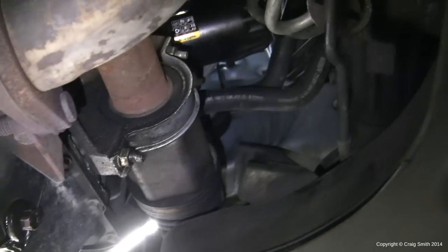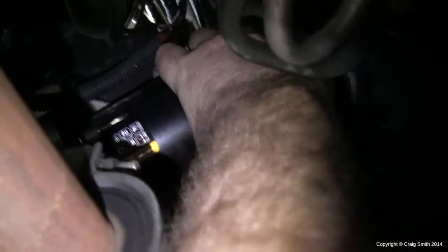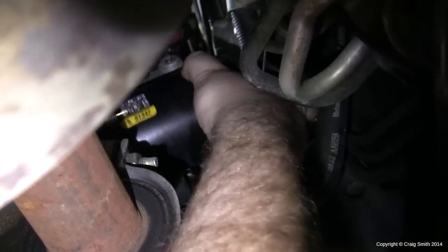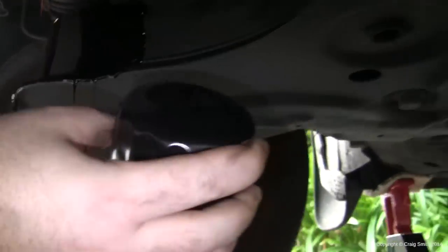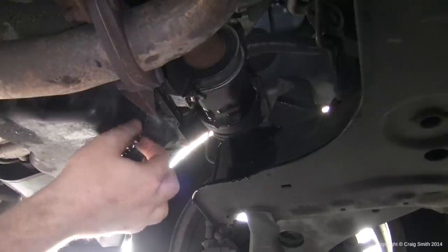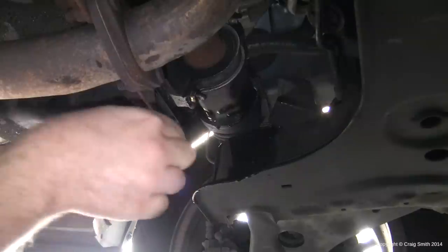We need to get up in there. I was able to do it by hand on this car — it wasn't done up particularly tight, which is nice. As you start unscrewing it, it's going to start draining oil out of the filter itself. It's unfortunate where it's placed — it makes a real mess because you get oil all down the back of the engine. But there's nothing for it, you just have to do it and take it out. Once you've done that, take out the drain plug again and just let the whole thing sit there for a while — maybe half an hour until it's mostly done dripping.